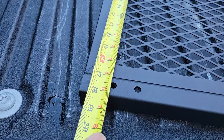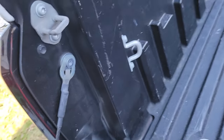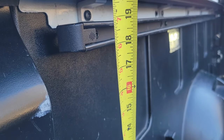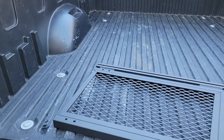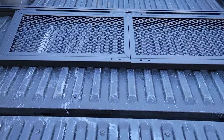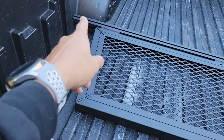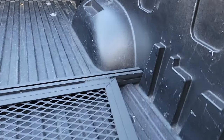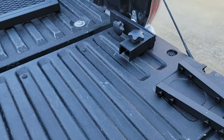From the top down you've got about 18 and an eighth inches on the bracket. Going down to the bed we have a good 19 inches, so we should have about three quarters of an inch of free play on the bottom. Height-wise it should work. I'm not sure what it's going to do going across — that may be the issue, but I could probably just cut the ends down if needed. Let's get these side brackets mounted on driver and passenger side and see what it looks like.